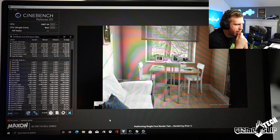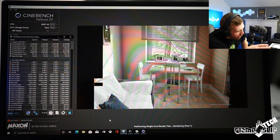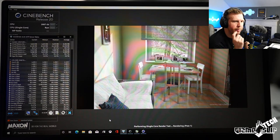But yeah, I would say the biggest thing is you'll want to do all of those things. So check drivers, update Windows, restart the machine, make sure you're in the right power profiles. So you're running on high performance mode with high fan mode. Run MSI Afterburner to see if anything's throttling or overheating, and then you should be able to discover the problem by then. Something is going to be throttling or overheating, or something's slowing you down. So you just got to figure out what it is and try to fix the problem.